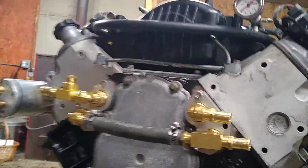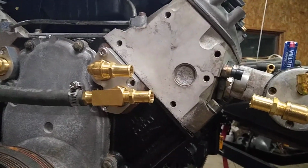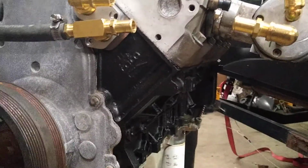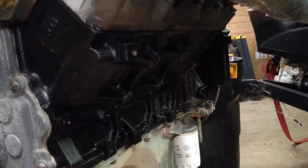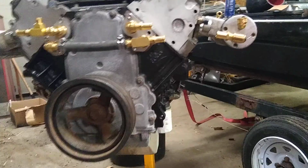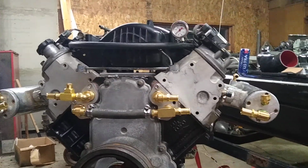So yeah, we got the motor all obviously cleaned up. You can see probably in the last video I posted with this thing, it was a mess, and we used an oven cleaner, which worked amazing. I've never used that before for cleaning an engine. I power washed it, and I could have rinsed it off with a garden hose. You don't even have to power wash it. The oven cleaner just eats the crud right off of it. It's unbelievable. So then we needle scaled the block, obviously because the block was all rust, and a buddy of mine just took this industrial epoxy and he didn't even tape it off. He just cut it all in and painted it. It's Bar Rust 235. It's made to be painted onto a rusted surface. It actually bonds better to that than a clean surface. It's really good stuff. I use it a lot at work. What else?